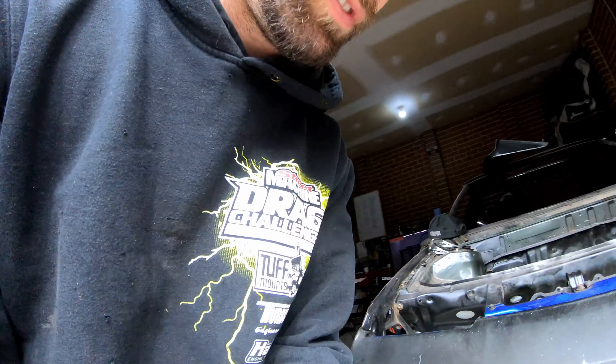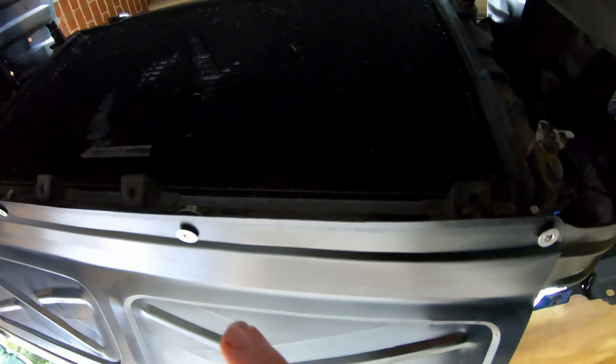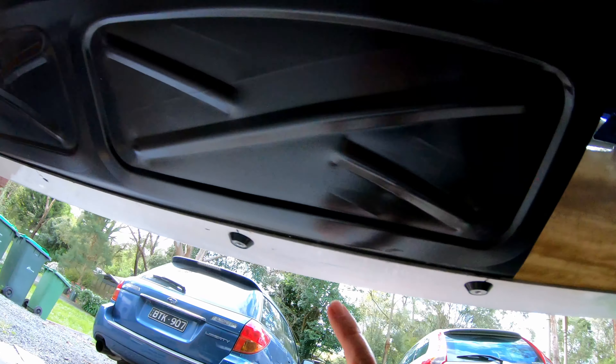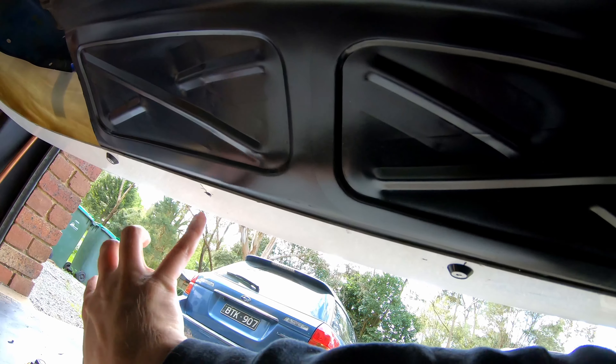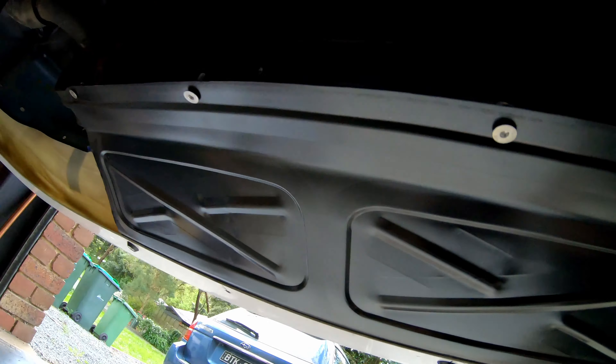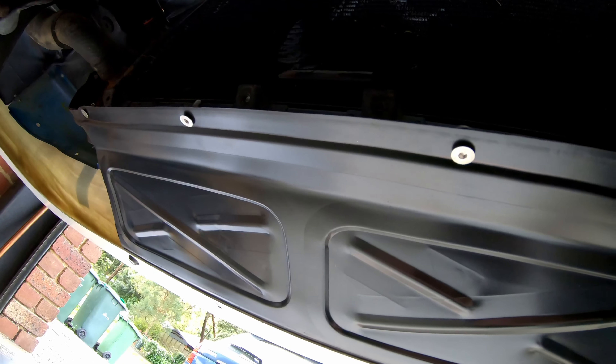Hey gang, it's Monday and I've got a few hours. Let's get under the car. Our plate here - I've actually put a little fold in it because there's a fold in the bar, so I've bent that bar up with a bead fold and it sits much nicer now. On the back side of these I have welded some captive nuts on all of those. I just need to extend this hole a bit to make that fit. They just screw in so you don't have to get a spanner on the back - that's nice. And as you can see, I gave it a coat of paint.